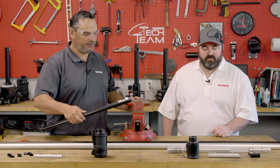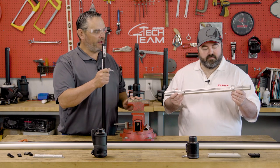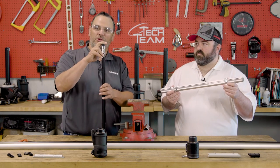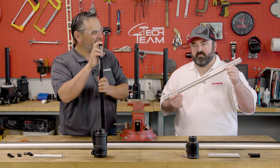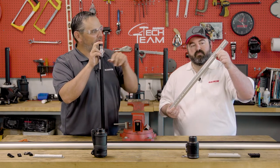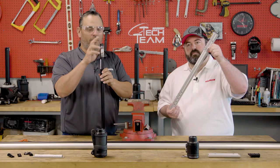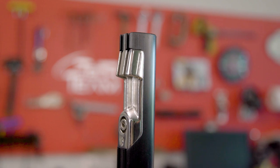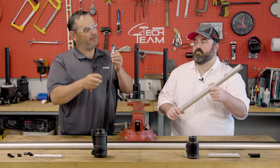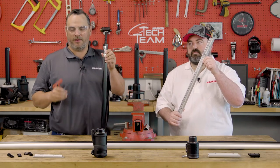Let's talk about the feeders. There is a difference between the Mark IV and the Ocean feeders because one has twin grooves on the Mark IV and there's a single groove on the Ocean series. The Ocean series is kept in with four screws on two tabs on each side, whereas the Mark IV is a single screw on a cast feeder, and the intent is that one's never coming off.